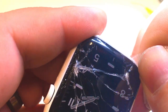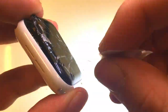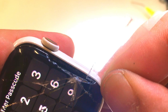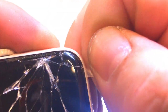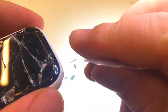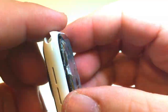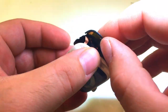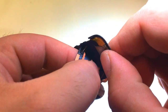Carefully working the piece of plastic, I can try to maneuver it around the edges, making sure I'm not damaging the display flex cables and the touch flex cables. You can see I lift the screen a little, which gives me better access points into removing the display from the force touch and frame. It's tricky and tedious, and things can go wrong if you haven't done this type of repair before. Either take an hour or two to do this part carefully, or just send it to me for repair — you'll see my website in the description where you can check out how to ship it to me.